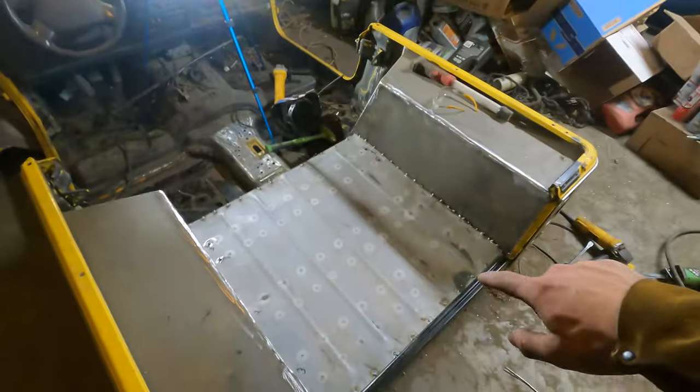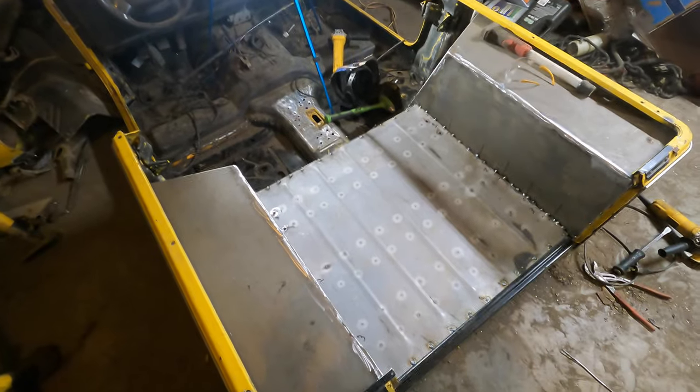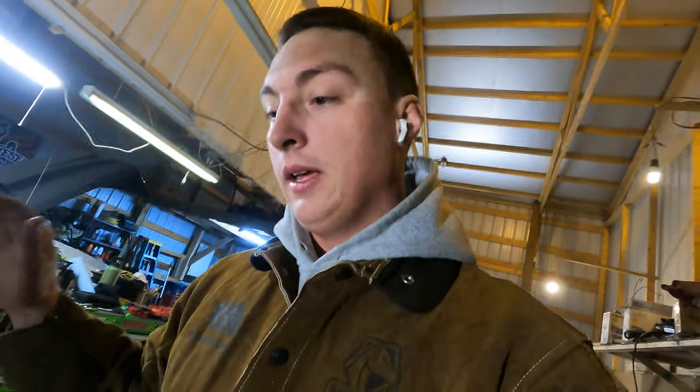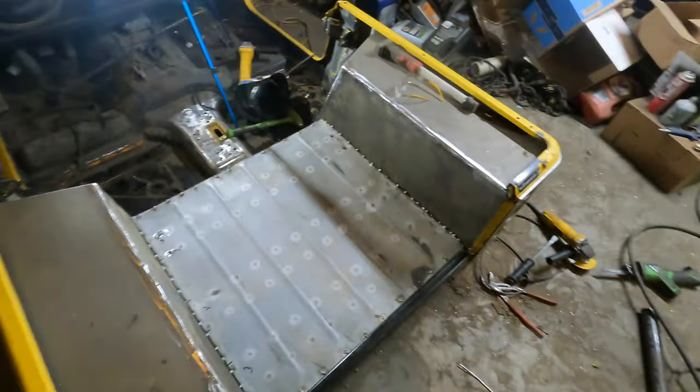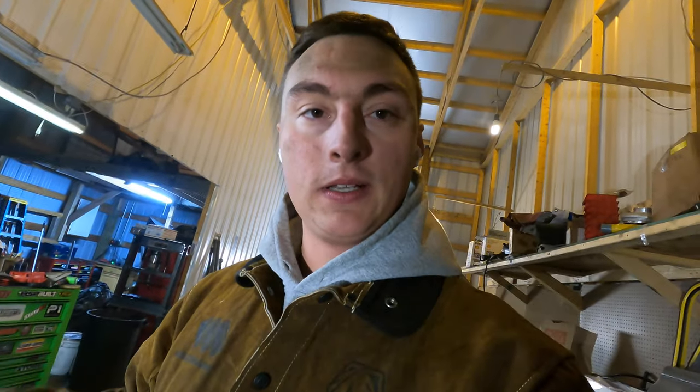Outside of welding the bottom of it — which I'm going to flip back up on its side and do once I finish all the spot welding for the rest of the rust repair — we've got the floor in. It's complete. A bunch of spot welds, a bunch of welds along the side. I'm going to continue welding along the side because we're going with the theory of stronger than stock — let's weld the crap out of it, honestly. There it is, finished product: Jeep floor with the MotoBuilt inner fenders. If you guys want to see the MotoBuilt inner fender install, look at episode 10. Thank you guys — if you have any questions or tips, hopefully this was more detailed for you. Don't forget to comment, like, and subscribe. Let's shoot this channel to the moon. Catch you guys on the next one.